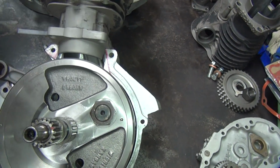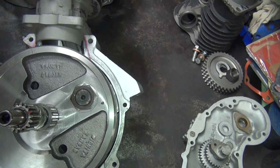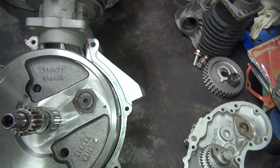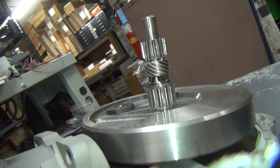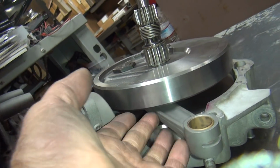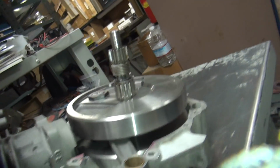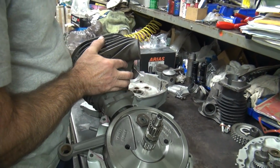They found that on those LS motors when they ran steel cranks and things. On my race bike, I used to cut the center of the flywheels out over here. I cut the flywheels out in here for a bigger gap, so that the air would have room to go between the flywheels when the piston went up and down at high RPM. Always thinking ahead.